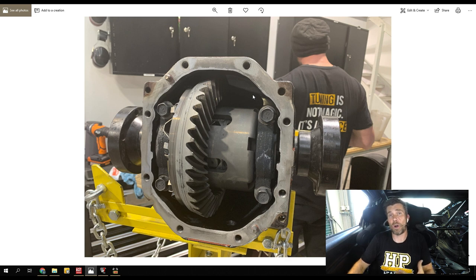Simply put, this is just the action of the LSD to lock up and supply torque evenly to both axles under acceleration versus braking. With a two-way LSD, it provides the same amount of locking force when engine torque is applied or when you're hard under brakes or engine braking — essentially locking both wheels together under braking. The drift guys tend to like this because it helps initiate a drift. For circuit racing though, this often isn't ideal because it tends to make the car want to push or understeer on corner entry. The 1.5-way LSD has different ramp angles on the power side and the overrun side, so under acceleration the diff locks up as desired, but on overrun it's not going to have quite such a vicious effect. A one-way LSD tends to provide no locking action on overrun at all — a lot of this comes down to car setup as well as personal preference.